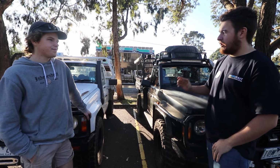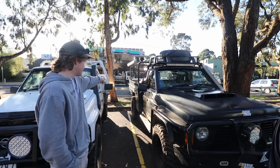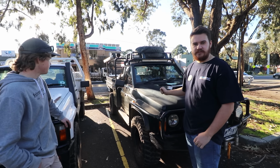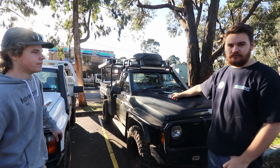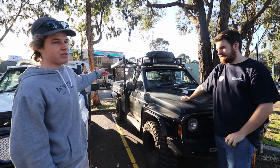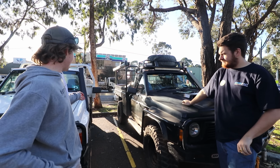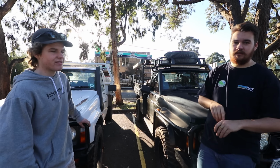Yeah, so also my car is a lot heavier than Liam's car. But you've got tyre, roof rack, tray sides still on. Side steps, scrub bars. I've got 200 litres of fuel on board. I only was carrying a 70 litre tank all day. And my fuel screw is wound all the way as far as it'll go. And that's another thing to consider. If I did have full weight of this car, my vehicle would be even slower again. So for him to do as well as it did against an unweighted, naturally aspirated vehicle, you can see how big the performance benefits are of a turbo.